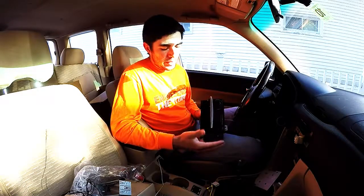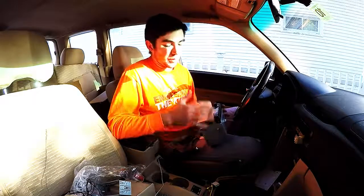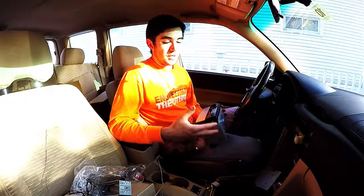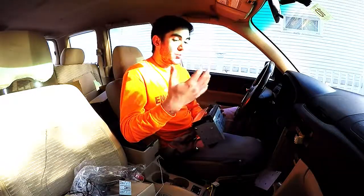As you can tell probably by me sitting here playing with it incessantly, I'm worried about this being able to open and close even relatively smoothly with this mounted above it so tight. What I can do in this situation is either sand down or Dremel off the edge of either the back of this on the DIN or on the lower half of this bracket on the bottom of the radio. Because I'm not positive it'll be an issue yet with it not being mounted, what I'm gonna do first is mount everything in, see how it lines up, and whether or not it even is an issue. Then if it is, I can pull it back out while everything is still apart, and remedy the situation then.